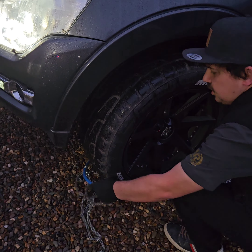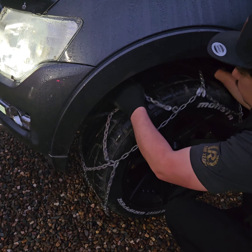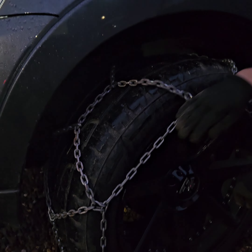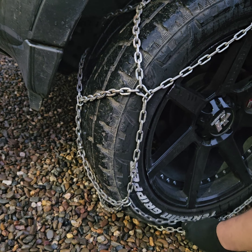At the ends of the chain, lift them up. Join that hook together up on top. Pull all the chain around. Silver clip hook up at the front. Slide the chain back so that blue plastic hoop is on the back sidewall. Silver chain with the red clips on the front, and these two verticals are in the centre of the tread, at the bottom of the wheel.